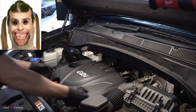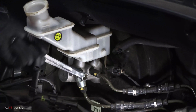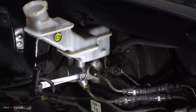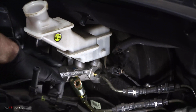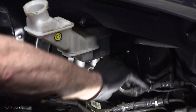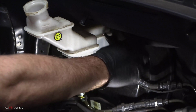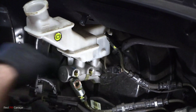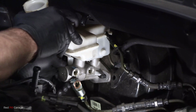Okay, next remove the engine beauty cover. Okay, next I'm going to remove the 12mm banjo bolt and the nut. And the 14mm nut. Now if that one there is really tight, don't use an open ender, you have to use a pipe spanner because you'll round that nut off and you'll stuff it. Just get your brake lines out of the way. Next, the nuts that hold the master cylinder onto the brake booster, and that should come straight out now.